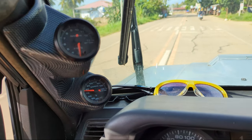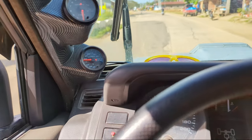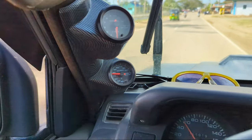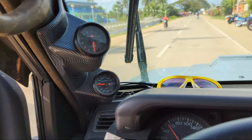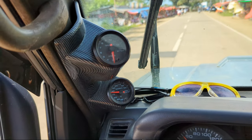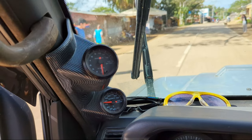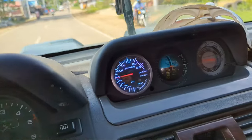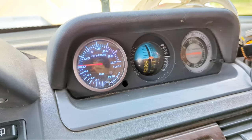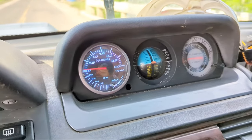Now it feels like we're driving a normal car. At normal traffic speed, around 70 kilometers an hour, temperature stays just under 80 — and now it's actually dropping down to 75. That's absolutely unheard of as far as I've owned this Pajero. The exhaust gas temperatures got up to 500 degrees Celsius under full acceleration, where the boost hit 1.2 bar. That's where the boost tops out now — I'm not going to do anything beyond that. Last time I was hitting 1.8, and that's way too far.